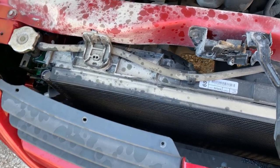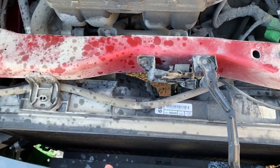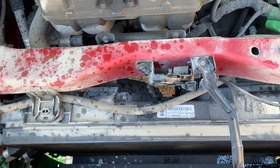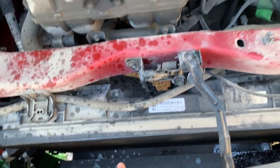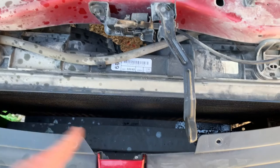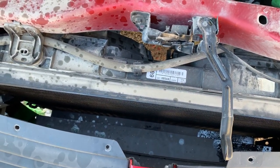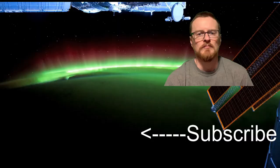I'm going to take it to an actual shop and let them refill it with Freon, pressure test everything, and double-check all my connections to make sure I've installed it properly. But this was way cheaper to order the part and do it myself because you save on the labor. It's not as bad as some of them though — it's all about access. I just took the top cover off here with some screws, and this thing just pops right out once you disconnect the four hoses.